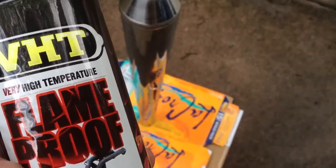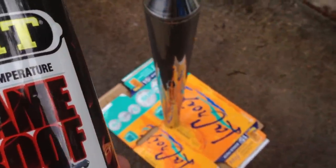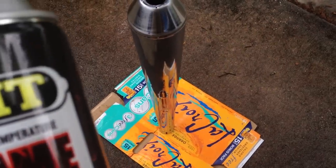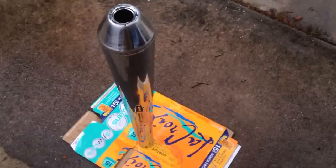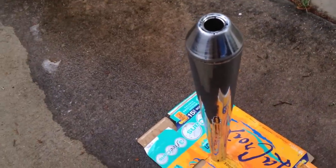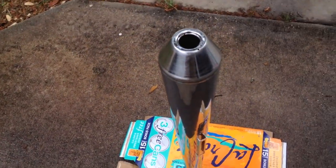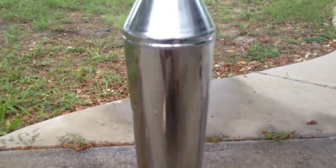Rinse down - see the water there? I'm going to go ahead and dry these and spray them. With the exhaust pipe nicely and securely resting on a pop can box with very low wind, go ahead and start spraying these down. Shake up your paint really well. Basically, it's going to be just real light coats like this onto that chrome.